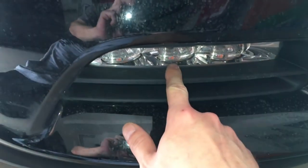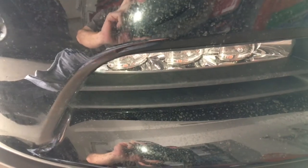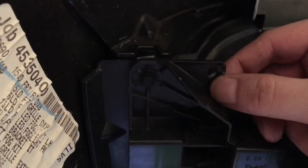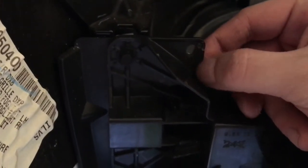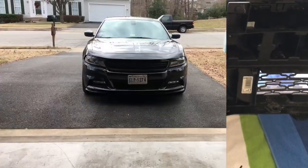The fog light will come off with the front bumper. To disconnect it, push that little red tab back with a screwdriver and press down on the black piece. The wiring for the fog lights connects here; I just broke off the clip that attached the wiring harness to the bumper — I didn't cut it, because I didn't want to cut any wires. I can just use zip ties to tie it back on. Same thing on the other side — no big deal, it's not going to hurt anything.